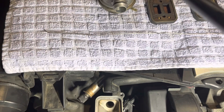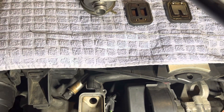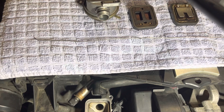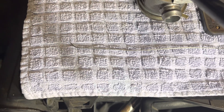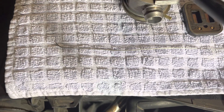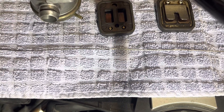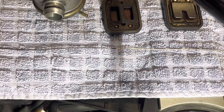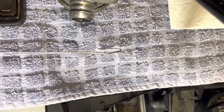The tool I made is this nickel-plated steel cable that I salvaged from my leftover cable job for my Porsche 911 heater levers. What I did was I put a 45-degree curved bend at the tip, about the same circumference as a dime — a 10-cent piece USD. I also modified it a little bit at the middle, about six and a half inches down — I put a little notch to let me know if I've hit the end of the tunnel. And then I put a little handle here so that I could turn it easily without having to damage the wire.